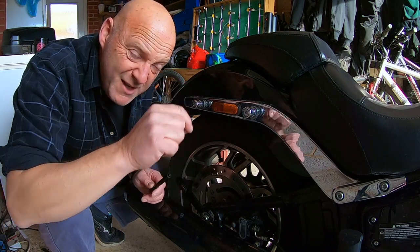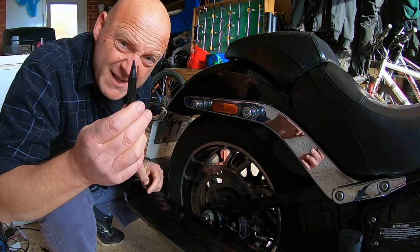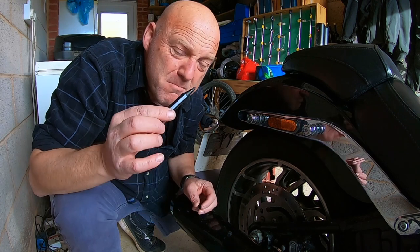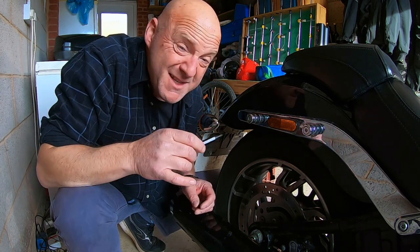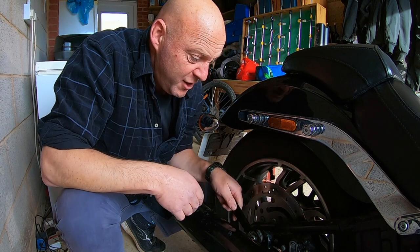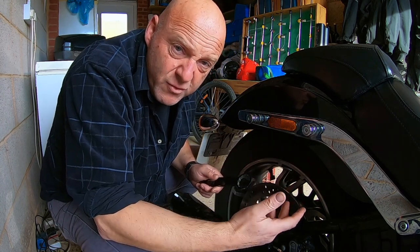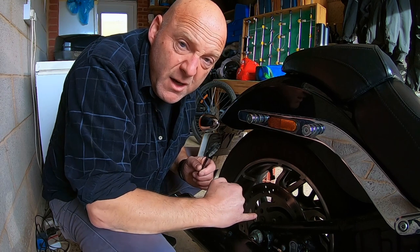When you come to re-torque it, you apply another mark or bit of marker paint. What I do before I set off is get some black marker and mark my frame and axle nut. A black marker on a black frame isn't ideal, so marker paint is better — I'll put a link in the description. So if you're on the side of the road, you undo your axle nut however you can, loosen off, do whatever you need to do to your rear wheel or belt tension, then turn it back up so the lines meet up.